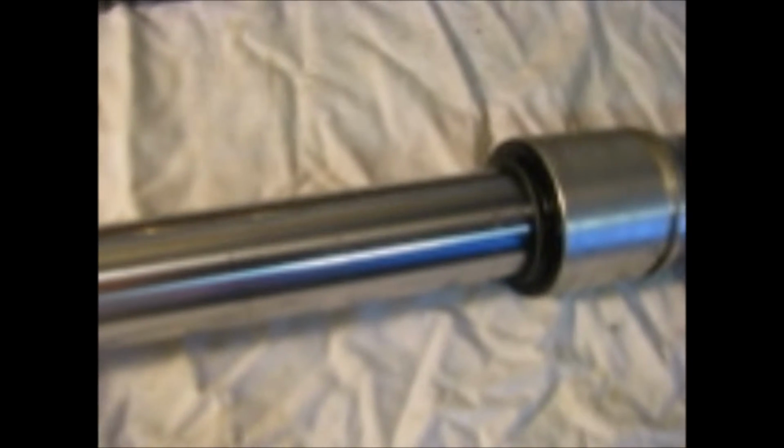Okay, so I'm going to take a blunt screwdriver and just try and work that out. Just be careful not to mess it up or anything. This one isn't quite as important as the seal, but it's still not good to scrape anything, because I'm going to try and reuse them anyways. These aren't the stock ones, these are aftermarket. I believe the stock ones on the 2007 CRFs have a metal ring that goes around the outside, but this one's just all rubber, so we'll start taking that out.